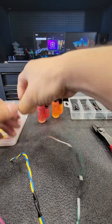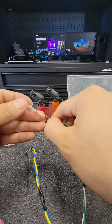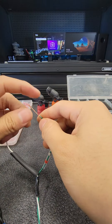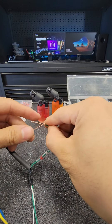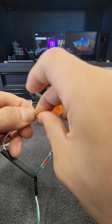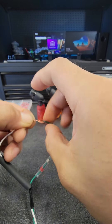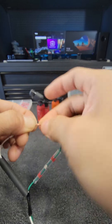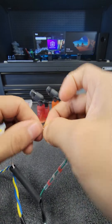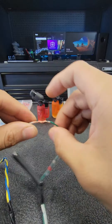Add the heat shrink before you put the wires together. After you're done twisting these individually, you want to twist them together. Grab it in the middle, make it like an X, and then just twist away. Do the same for the other side and there you go — joined together.